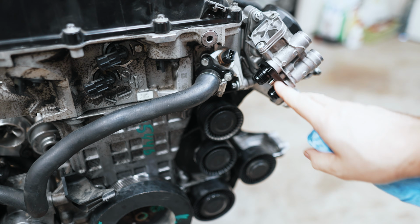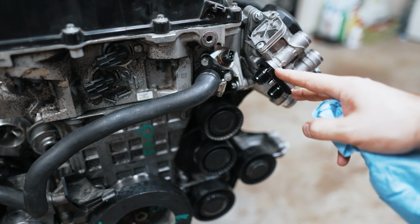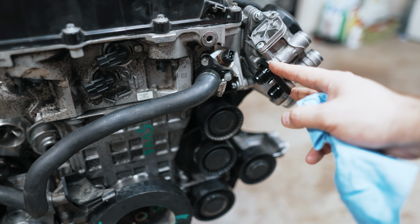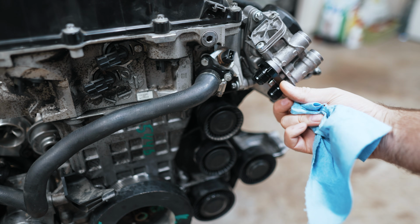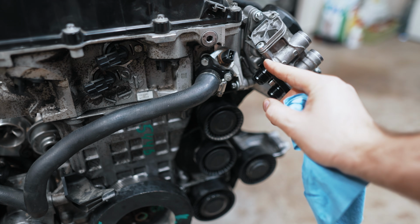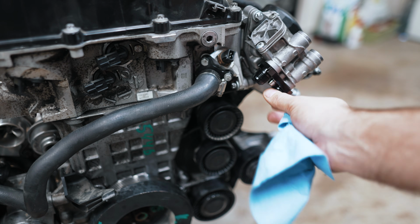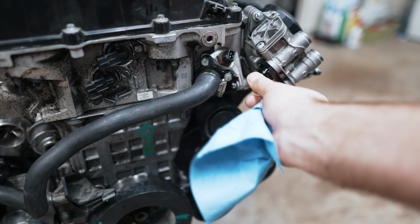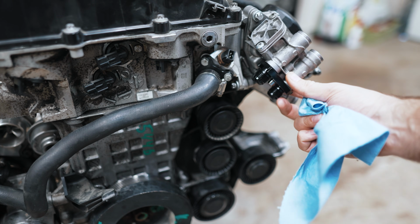So again, I'll put a link in the description for the oil cooler kit and the O-rings. From what I've read, there was a version of this kit back in the day that included O-rings that weren't of the best quality, and people encountered leaks here. But then there was also a fixed flange. This is an updated flange because it can kind of move left and right to help this thing center itself. These pieces are loose in there until you tighten the bolt. And then the O-ring, if you use OEM O-rings and you get these situated exactly where they would want to naturally sit, you should be good and not have any leaks.